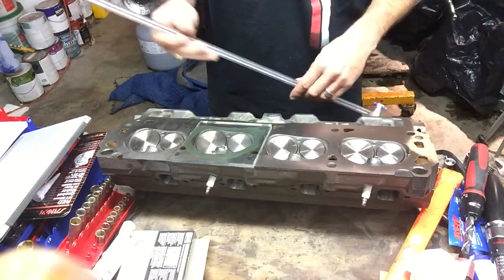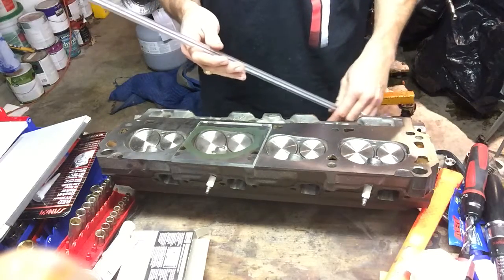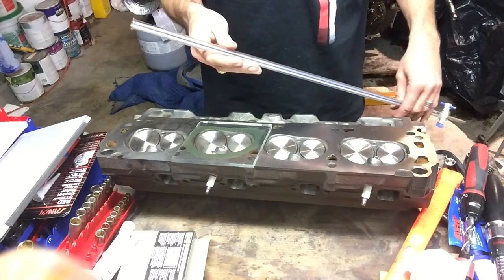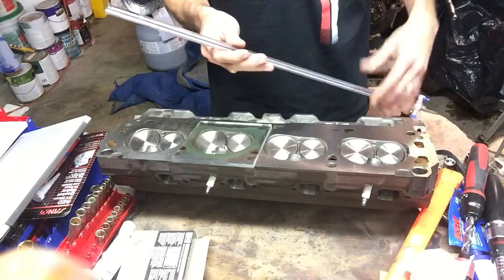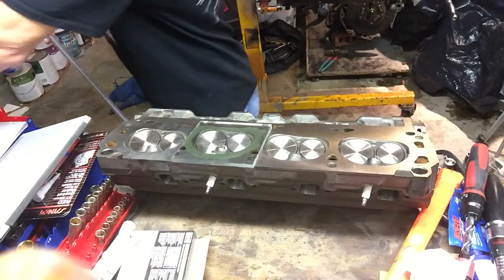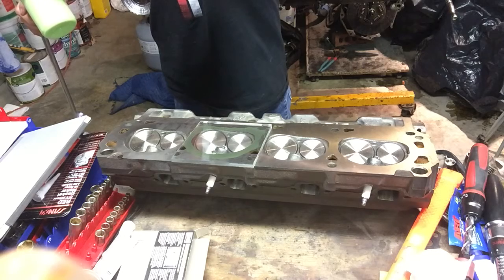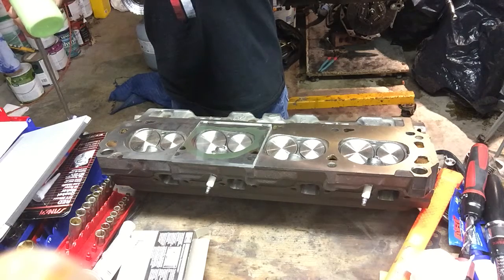I know these combustion chambers are going to be greater than 50 cc's, so we'll have to refill it. You can do this with a syringe, or any measuring device that'll reasonably accurately measure CCs. The only thing I don't like about a syringe is you have to refill it many times, which if you have small error, you can have that small error many times over. So I'm going to fill my tube with water, straight tap water, to something greater than 50 CCs, and then we'll drop the level down to 50 CCs and go from there.